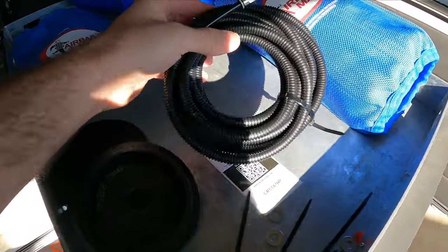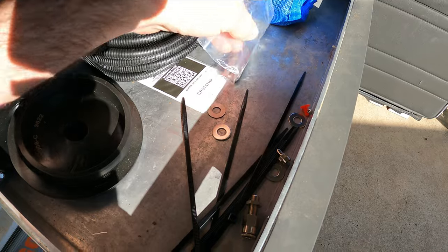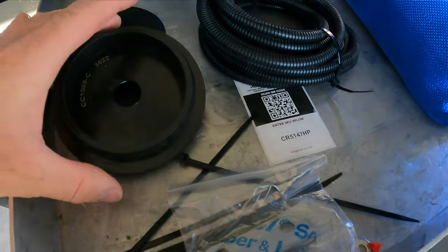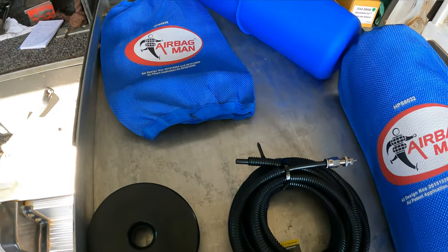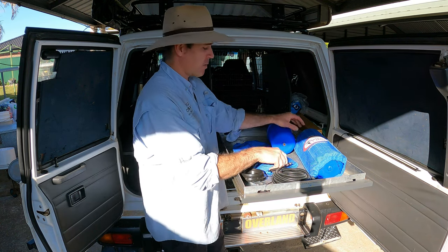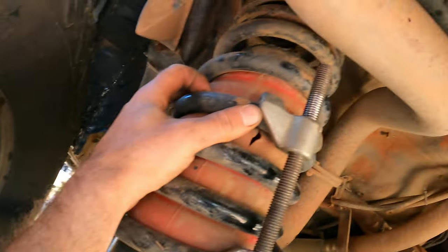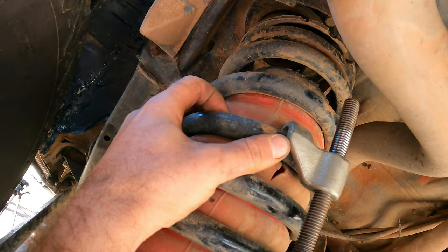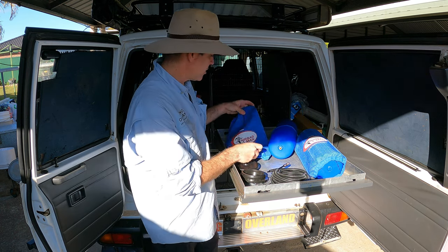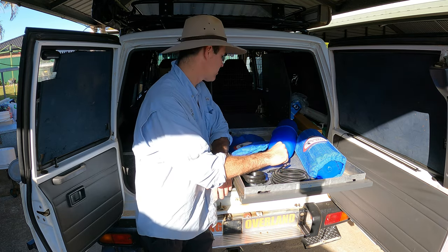That's fantastic. And for me, our channel is about honesty and gear that I want to run. The old airbags are a different brand, and these ones have a bit of a different setup, and it's a lot more reliable with how the airlines run. And with these new bags that cover the airbags, they're a lot less prone to holes like we've got in the original ones, and they can hold more pressure. These ones can actually hold up to 60 psi, so these covers just help hold that airbag together, and also protect it against things like rocks and even the sharpness of your coils if you get a bit of rust on them.